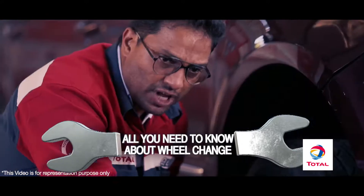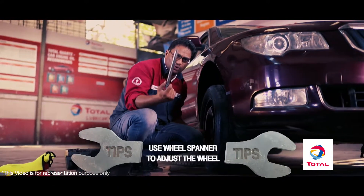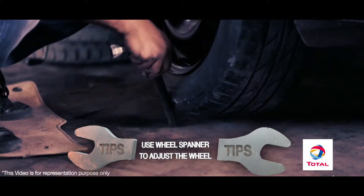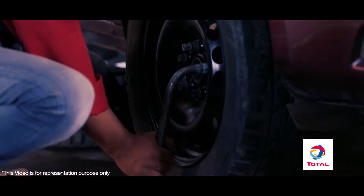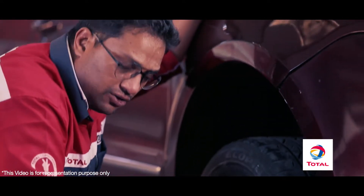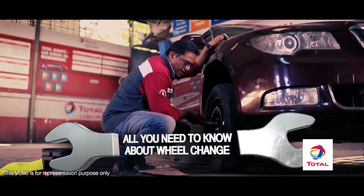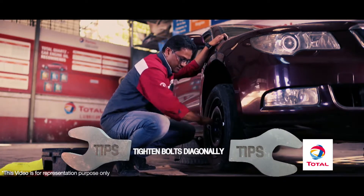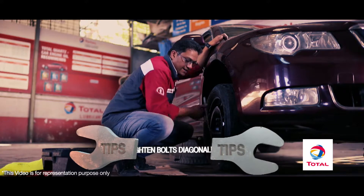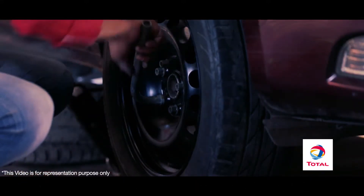Here's another tip: if you're not able to lift the wheel and tyre onto the hub, you can simply use your wheel spanner — place the wheel spanner up and there you go. Once you've tightened the first bolt, remember there's a technique to tightening the bolts so that you distribute the load equally. After the first bolt is tightened, diagonally go across to the other one, then another and so on until all the bolts are tight.